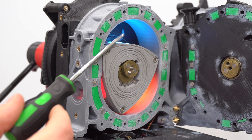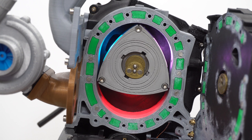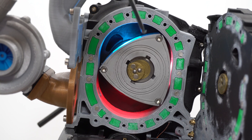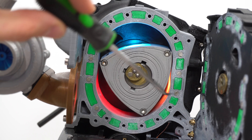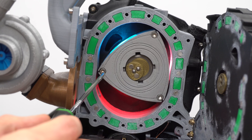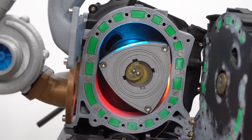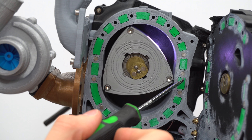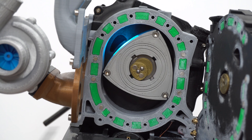Sealing off these combustion chambers is another big problem with these engines, and part of the reason is that there are different areas with different temperatures within the rotor housing. The top of the rotor is where you always have that intake stroke occurring, versus you have that power stroke occurring on the bottom right, and your exhaust continuing along the bottom. Because of that you have a cool section on top with a hot section on the bottom. Metals don't like to be at all these different temperatures when you're trying to seal something, so from a sealing perspective it's quite a challenge. To help mitigate this, you have coolant jackets wrapped around the engine attempting to create an even temperature — that's what you see here in green on the engine, those different coolant jackets.